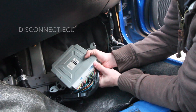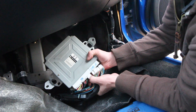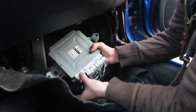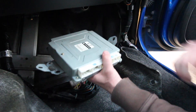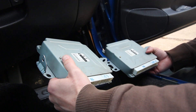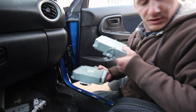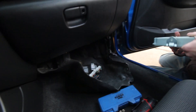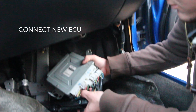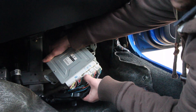And they should just go in order. There we go. Alright — exact same numbers, we're good. Sweet. I think this came off of a 2002. So same thing — 2002 to 2003, same ECU. And you can't really mess this up, they stayed in the same order. I mean, you probably can, but just don't. If you're a very special person.